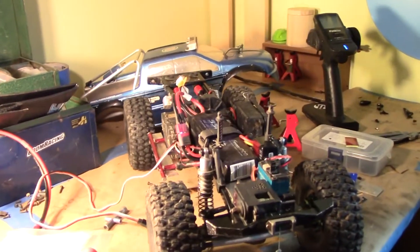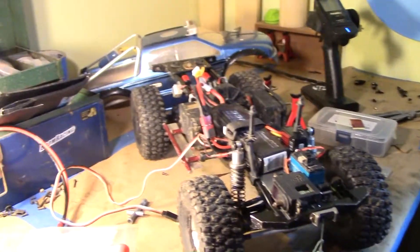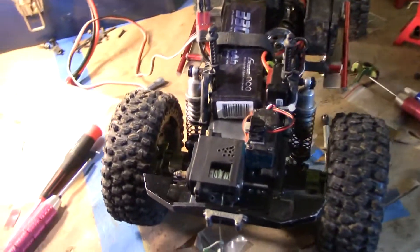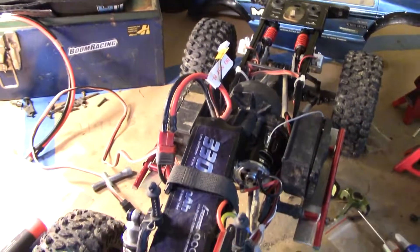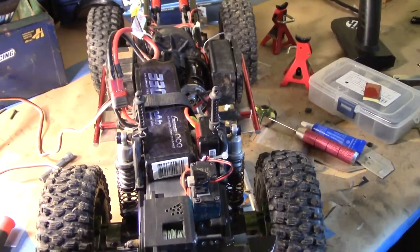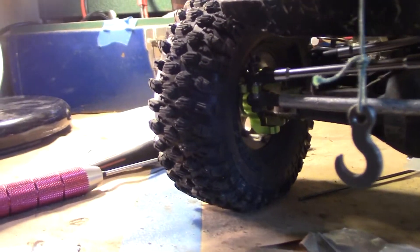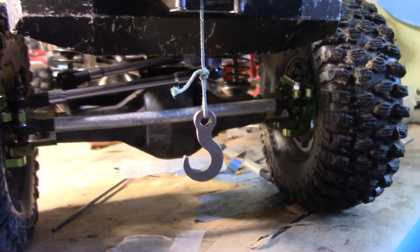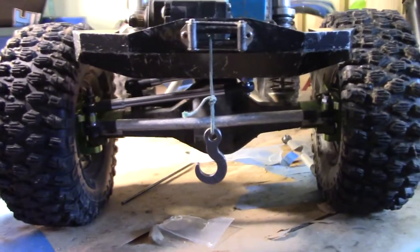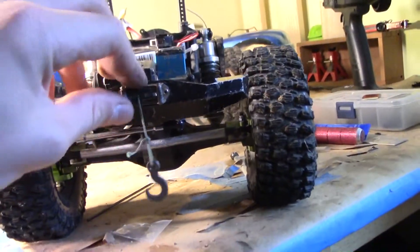And here it is all done. I know I skipped ahead a little bit, sorry about that, but I just kind of wanted to get this thing done. All the electronics and everything are back in, everything's routed, all my lights are working, everything works. I put the tires on. The other thing that I did was I put on some high clearance knuckles — you can't really see them very well, but they're definitely higher clearance. They do have a little rubbing issue which I just kind of resolved. Everything looks really good, suspension articulates really well, and I'm just really happy with it in general.